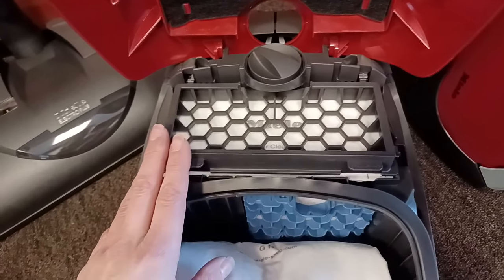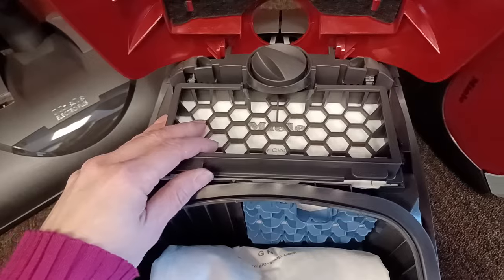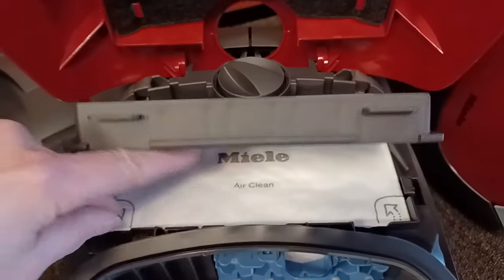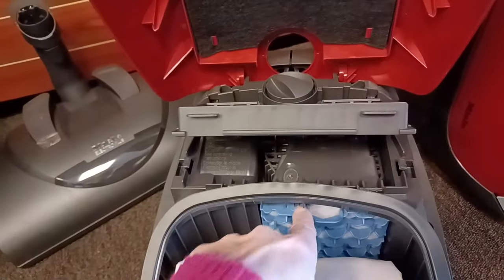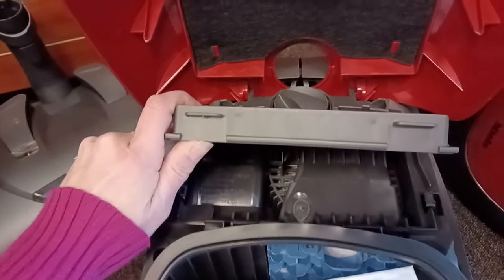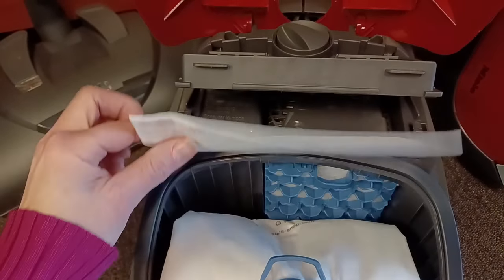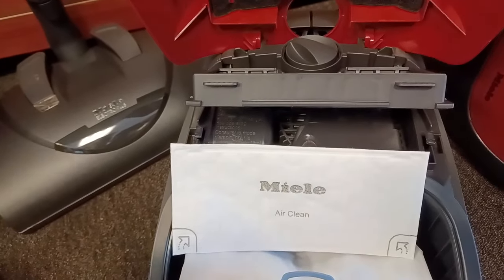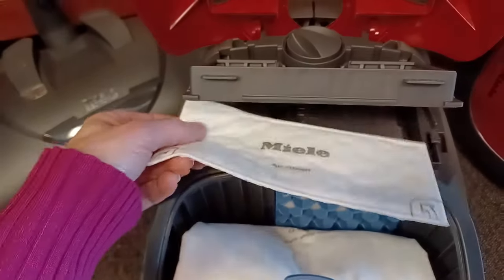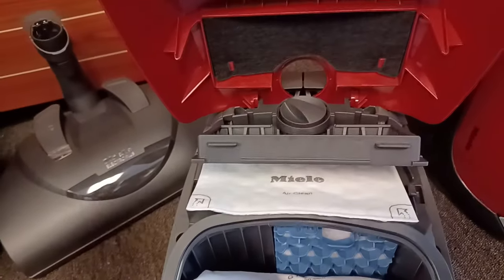If you had bought a lower-end C1 Classic vacuum cleaner — like a Turbo Team or a Pure Suction — this cage is all you would get. What's underneath it is the Miele Air Clean filter. These thin filters come in the boxes of bags along with the pre-motor filter. The motor is down under this cover. This is a basic Air Clean filter. The top always stays looking pretty good, but the underside will eventually turn black with the motor carbon byproduct, plus a tiny amount of debris that escapes the bag. But this filter is relatively porous, so very fine allergen particulate is small enough to pass through and out into the atmosphere.